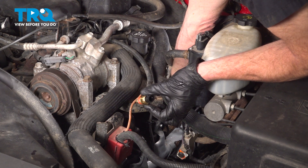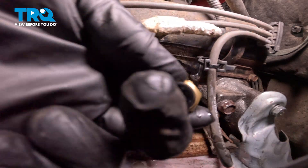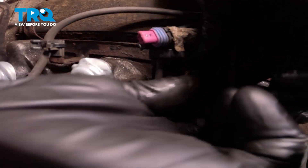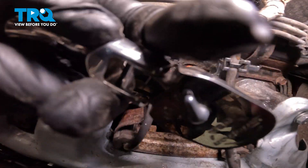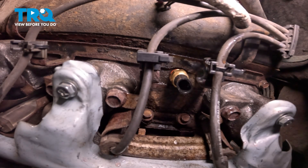It's time for installation of our brand new coolant temp sensor. Let's take this and put it in place. Keep in mind when you go to tighten this, we're only tightening it in approximately halfway up the threads. We've tightened the sensor so that approximately half of the threaded area is inside of the engine and it's nice and tight. Let's make sure we torque this to 15 foot-pounds.